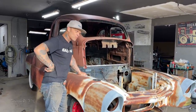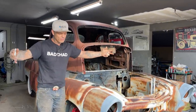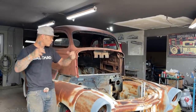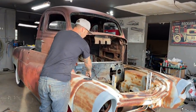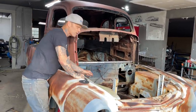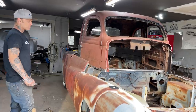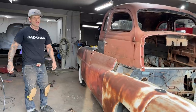We buy it from Speedway Motors. They have a cross member that's a tubular cross member. It's just at a length. You have your mounts, your mounting bracket. You have your mounts for your engine and your mounts on your round tubing. You would mount it to your engine. You'd pick it up. You put it in there. You set it where you want it with your good engine, your dummy engine, whatever you want. You would weld the round tubing to where it fits, or cut it off to length to put it where you want it, and it's pretty well that basic. And they have the exact same thing for transmission. So there's tubular transmission mounts too. I like to buy them. They're cheap, they're fast, they're easy.